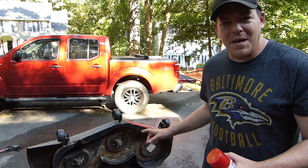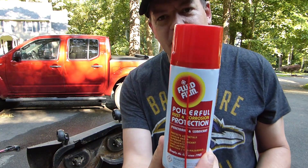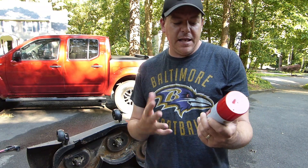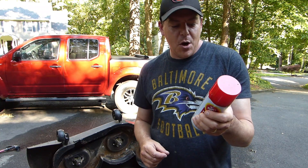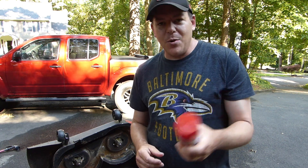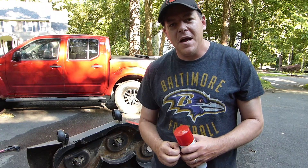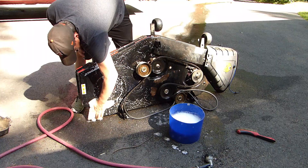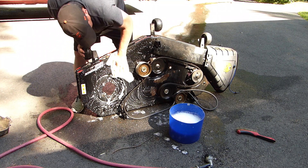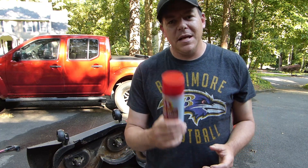Also in the process, I realized there's quite a bit of corrosion — you can see it right there. So I got online, looked at what to do about that, and came up with Fluid Film as a solution. This is an eco-friendly, lanolin-based lubricant, and it says right on the bottle that it can be applied over tightly adhering rust, dry or damp metal surfaces. I scraped all the dirt, debris, and grass clippings out, used a wire brush to loosen up any loose rust, then scrubbed the whole thing with a regular automotive-type cleaner, rinsed it off, and let it dry completely.